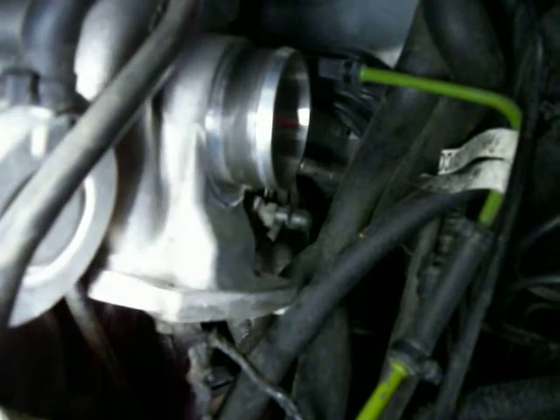I have that capped off, and we've got the wastegate line, which is right here — it's a black line. It's winding all the way right underneath the green line on solenoid number two.